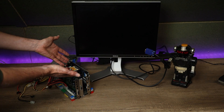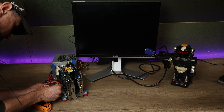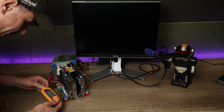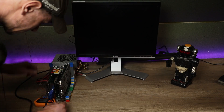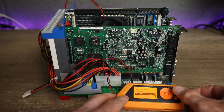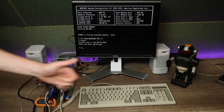The CPU socket came pre-populated with a 486 CPU — not sure which one, but we're going to find out soon. We don't have a power on/off switch, but there is a PS-ON connector on the main board, so I'll connect five volts and ground and kick it on with my Flipper Zero — that should work. We also need VGA, a keyboard, and speakers for sound. There we go — we have an AMD X5!